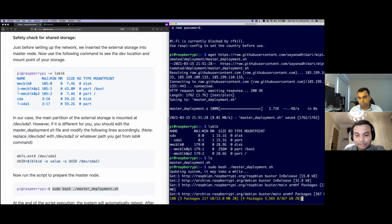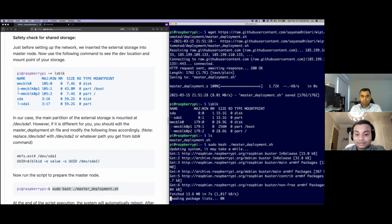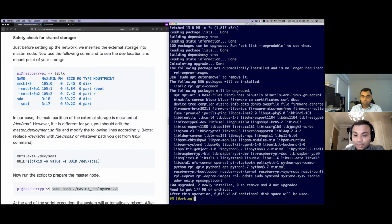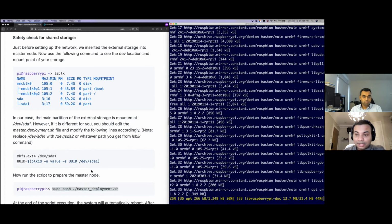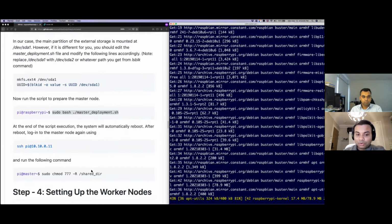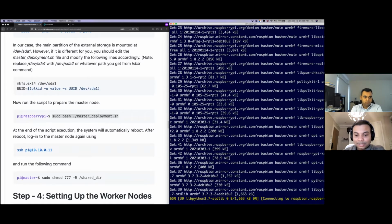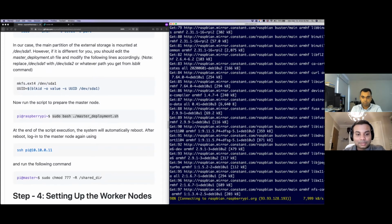And press enter and then wait. One particular problem that you might face here: if your router is not properly configured to the internet, if it is not connected to the internet, then this part will not execute. So it is very essential that you connect the router that you're going to use for this to the internet port of your main router, or to the LAN port that you're using in your institutes or schools or colleges or wherever you are trying to do this.